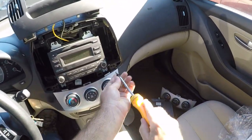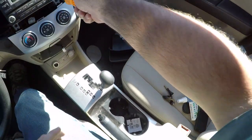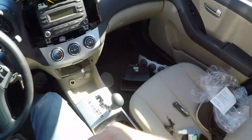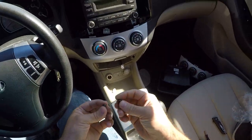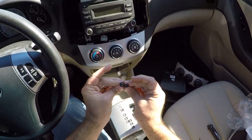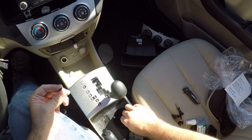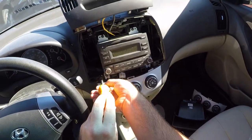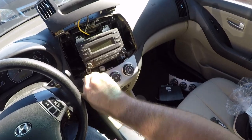Put it back in — we just reversed the procedure. All six screws — the four that are hidden are identical. The two short ones that have a smaller head — like it's a built-in washer, it's still a number two Phillips — those two short ones are the ones that hold in the pocket with the ashtray in it.